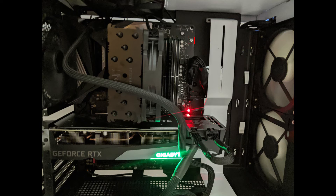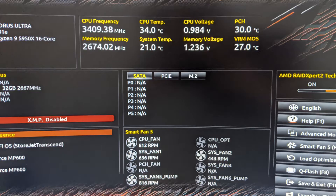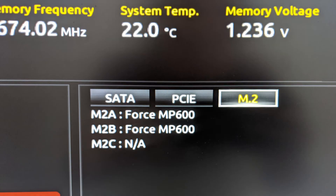I had to get a USB drive, format it to FAT32, put on the BIOS file, plug it into the USB slot, and press the QFlash button. A little while later I got screen feedback — it flashed the BIOS and everything was good. I checked to make sure temps were okay, that it detected the M.2 NVMEs, and looked at the BIOS to make sure everything looked correct. Everything did look correct.